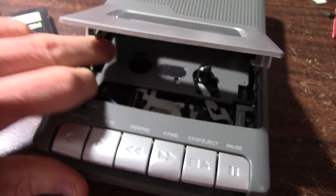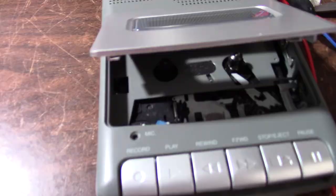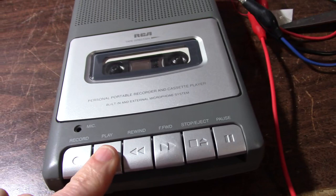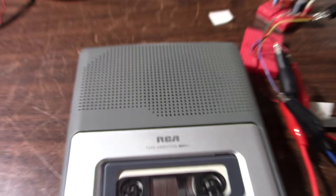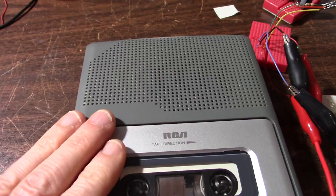I wonder if it has a wonky record-play switch. I'm trying to push that button in there — push that button and record lever down — see if that cleans the switch. Push that button a few times. Let's see what's going on now. That's usually what goes wrong with these things. Maybe it is that switch. Maybe it's just dirty. Because I was getting nothing before, now I'm kind of getting a slight signal through it. Let me pop this open and give it a spray job. See what happens.